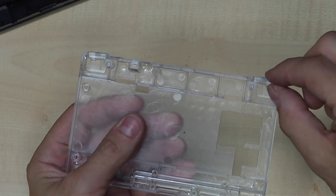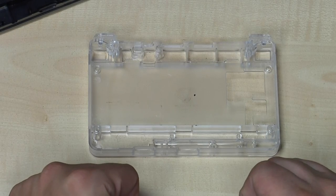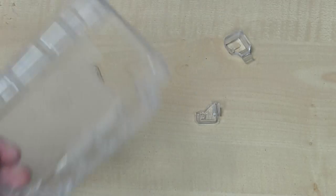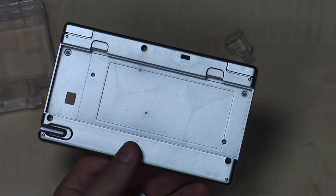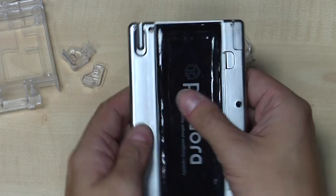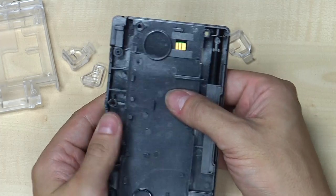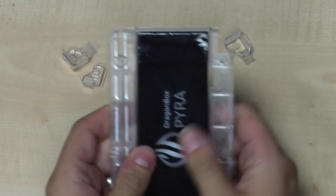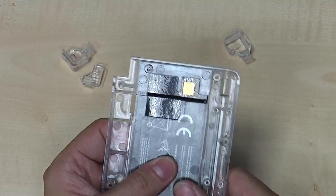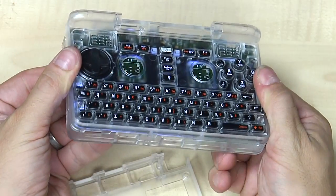The shoulder buttons are still being tweaked — they wiggle too much up and down, which they shouldn't. That's currently being worked on. Now, something to do with the battery: on the Pandora we had a lot of problems — when the unit got hit it lost battery contact, simply because the battery can move around a lot and the contacts move left and right. This has been fixed on the Pyra: it doesn't wiggle at all, no padding needed, it just works. This has already been proven — it can light up, and I'll show that in the dark because it looks a lot better.